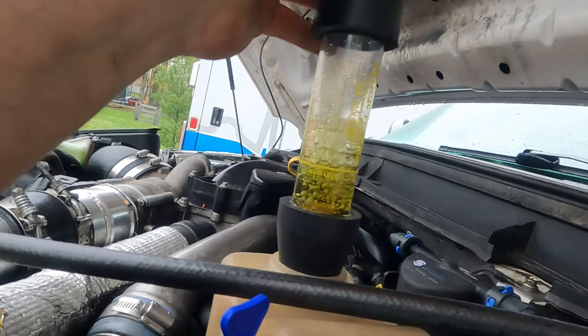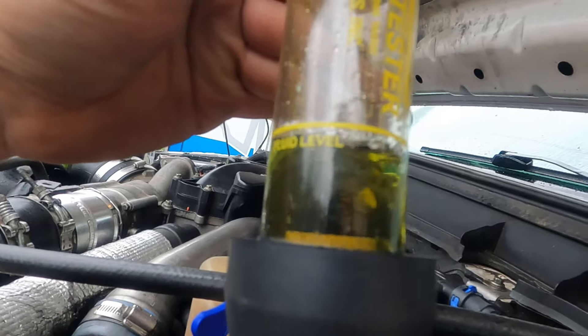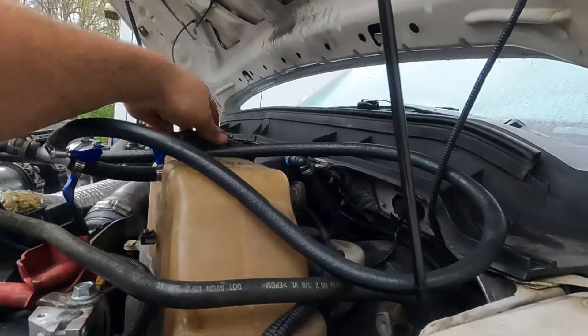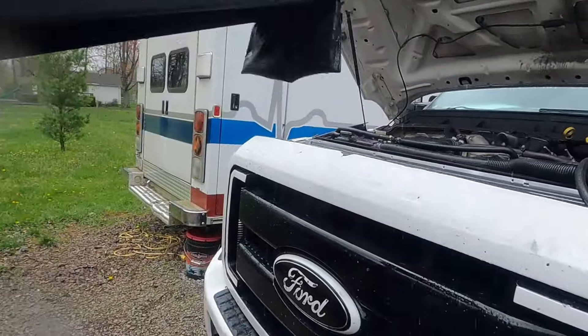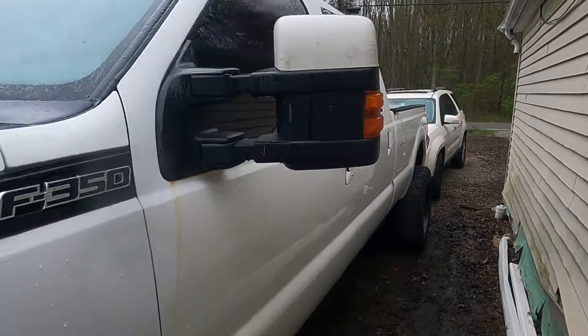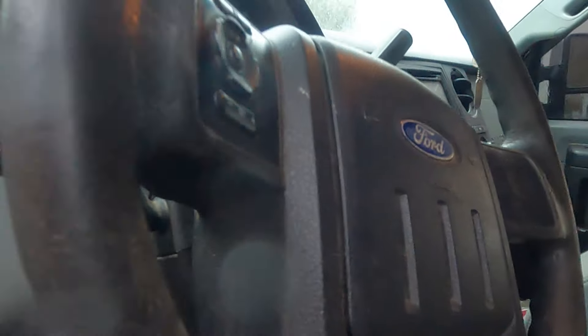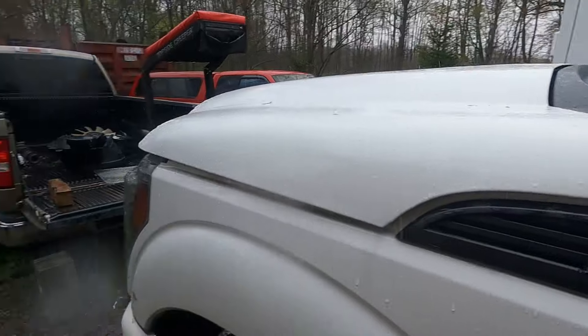Okay, so there we go — it didn't take but a few minutes, maybe two minutes after I turned the camera off, and you can see it went from a dark purple to a clearish green color. To me that means blown head gaskets or cracked heads. Either way, the heads are coming off — we're going to do it right here in the driveway. You guys are going to get to see it; it's going to have to be a multiple-part series because I'm going to show you how to tear this thing completely apart. We're going to check the rockers and other things — if you guys haven't seen my video on the rocker arms going bad on these early-model 6.7s, you're going to see it on this one.